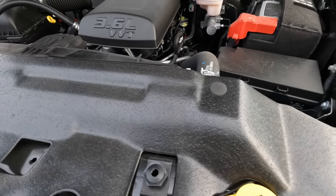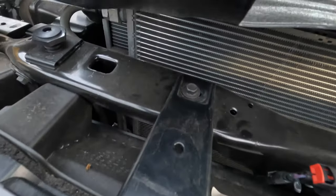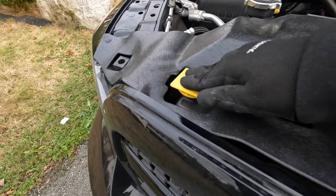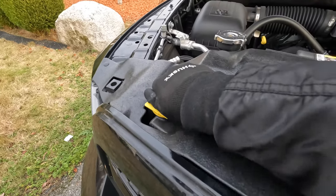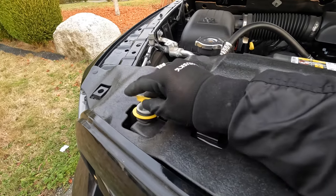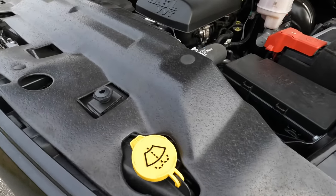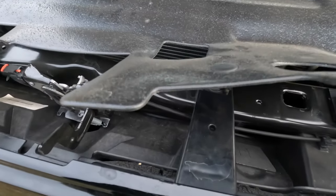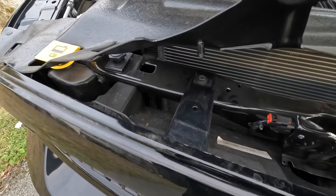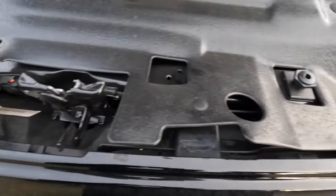I won't be removing this clip and this clip because if I move this I have more than enough room to remove that screw there, this screw here, this screw, and then this screw. Also, when you move this up it might open the coolant tank — just make sure you close it after. Now we have a few 10mm screws we need to remove — one on this side, one over here, one over here, and one over here — total four screws on top of the grill.